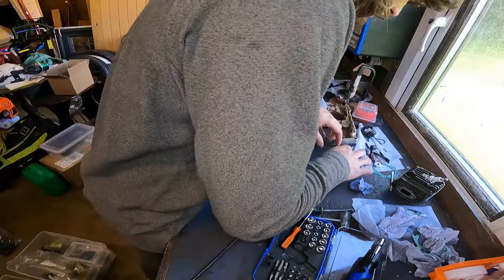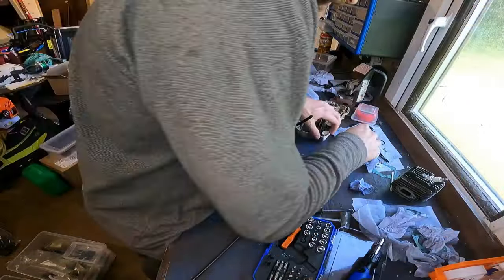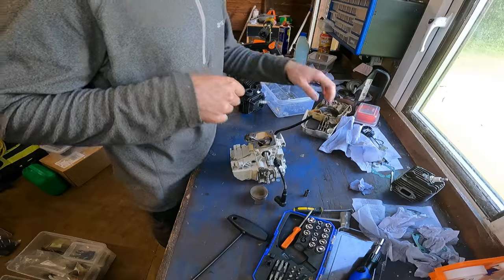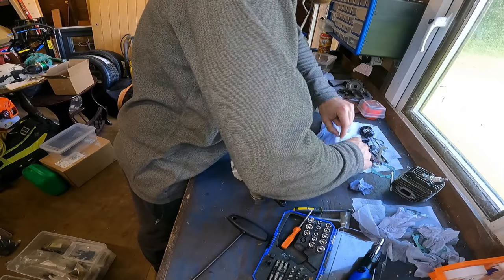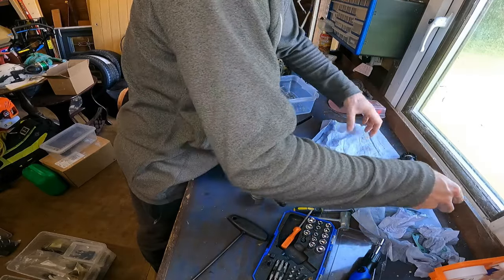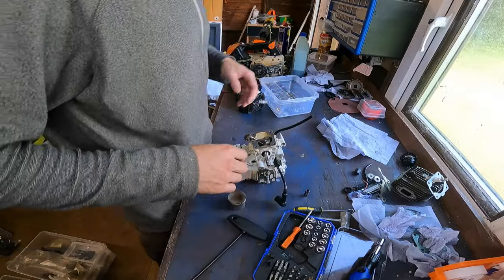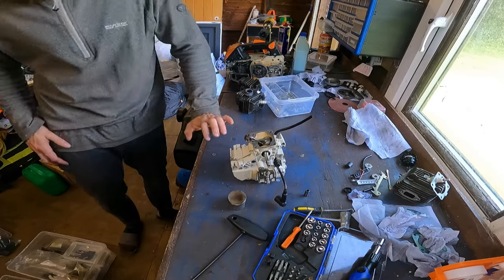And just see. So what we need is obviously the piston pin, which is there. We'll need our little, wherever it's gone. Let's have a look. What do I need? Don't need that. Our little piston circlip, which has decided to disappear. It's our fresh gasket. There it is. Little clip that we need to put in once we've got it in. But we also need our needle bearing. So I shall dig that out.